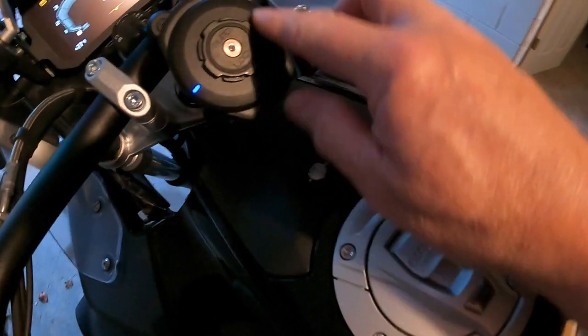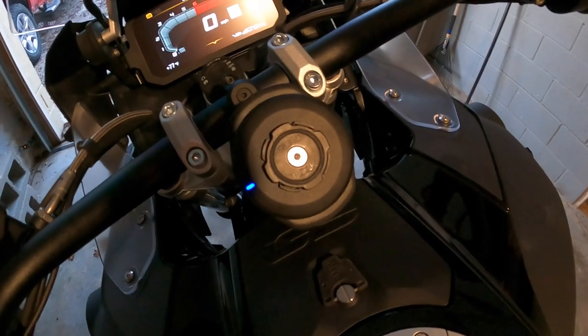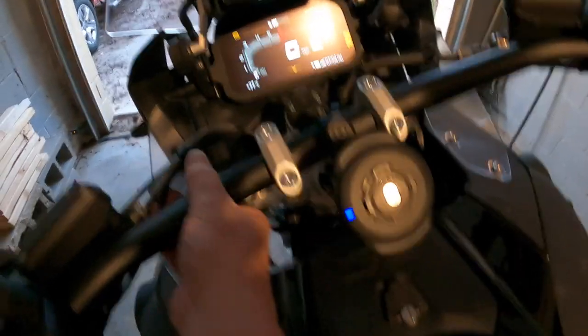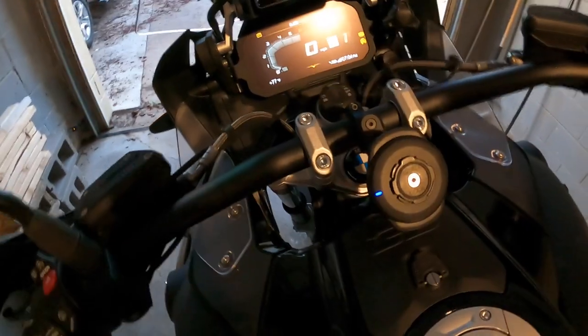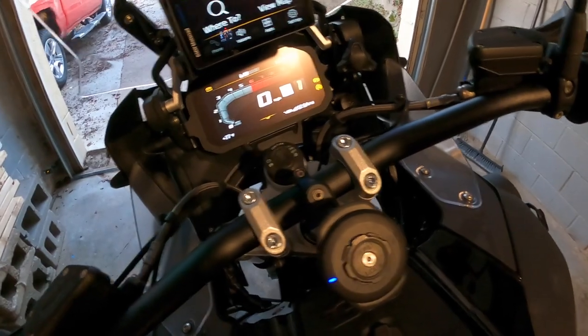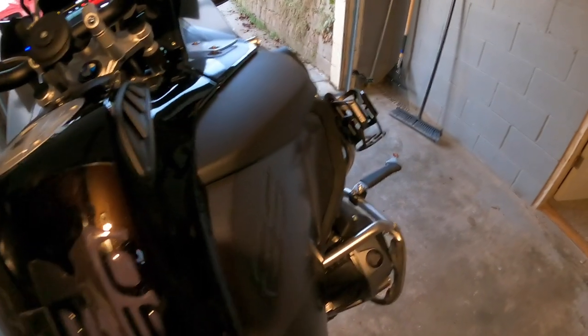This is your QI portion right here. There are certain things you don't skimp on - phone holders, for example. You can buy the clamp-ons and run your wire over there; just make sure you leave enough loose wire so when you turn the handlebars you've got plenty of slack and it doesn't pinch anything.